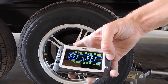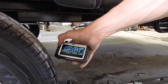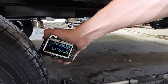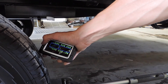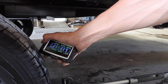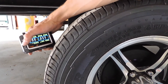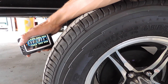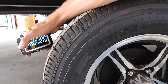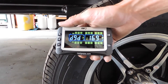We're going to scroll over to the rear tire on the other side and do the same as last time — hit our Set button, Fs are flashing, hit Go, get our six-digit code, hit Set. Then move up to the front tire, hit Set, Go, wait for the code, Set again. That's how you program all your tire sensors.